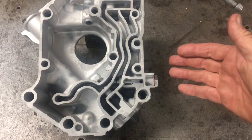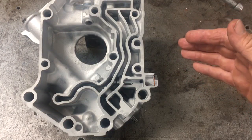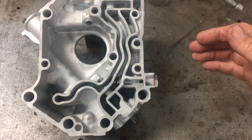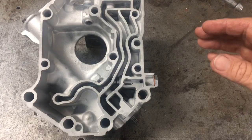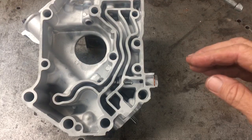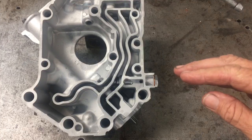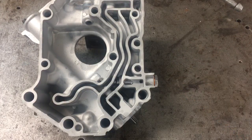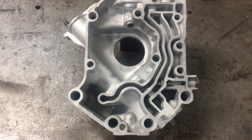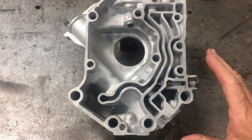There you have it — a look at the oil pressure regulator on a Corvair. A very, very simple system. While many engines have much more complicated systems, you really don't need it on an air-cooled Corvair motor in an airplane. There's a lot of talk about temperature-sensitive thermostats and all of that, but we're using multi-viscosity, high-quality oil in an engine designed for those oils. This system has been long proven to work — we've delivered hundreds of these to builders. This is the appropriate choice for a successful Corvair engine installation. A quick look at the Corvair's oil pressure regulation system and the slight modifications we make to it so that it works with the high-volume oil pump we have specifically for flight engines.